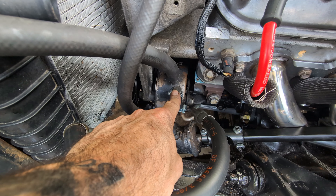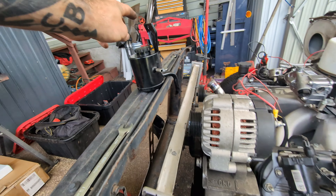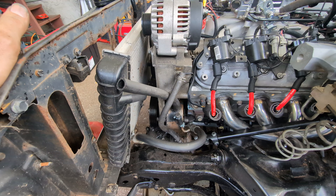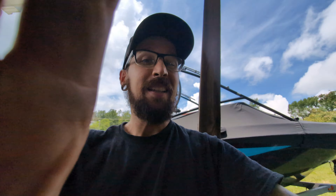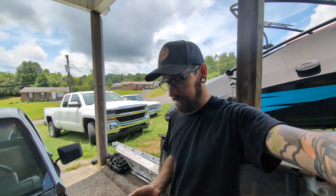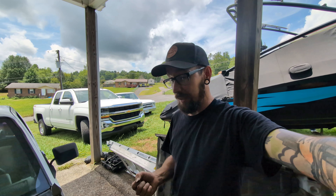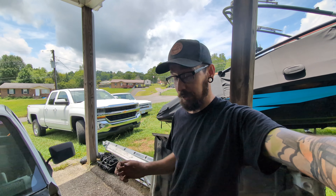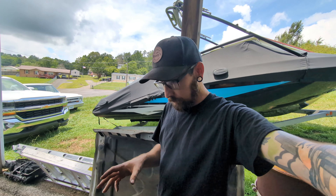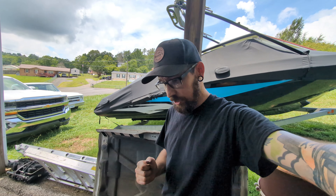This is janky, but I don't need it because this pump came off a van that had hydroboost — at least the best I can figure out, that's what this was for. There's a low pressure feed for that, I believe. These hoses here are set up for this reservoir. I've got to figure out where I'm going to mount it and then I can change those around. You might be wondering why aren't you just using a power steering pump that has a reservoir on it to save you that hassle? That would be better, but I don't have that and I have this, so we're going to see if we can make it work.